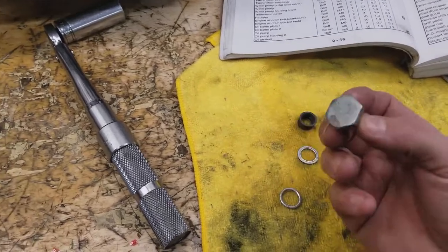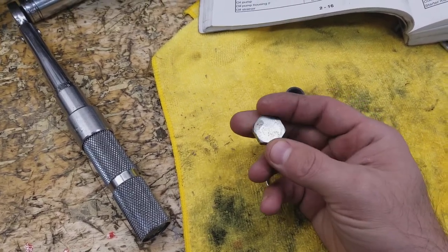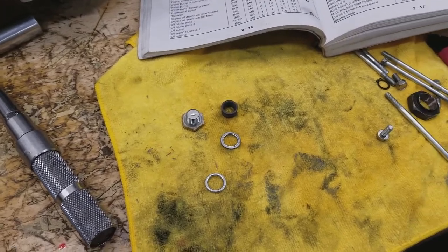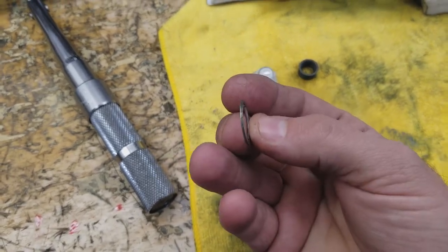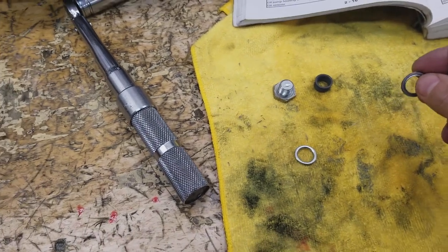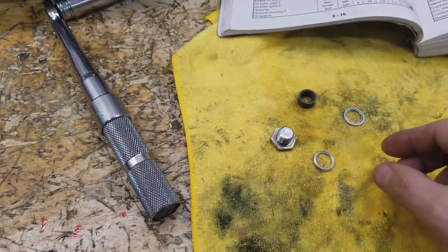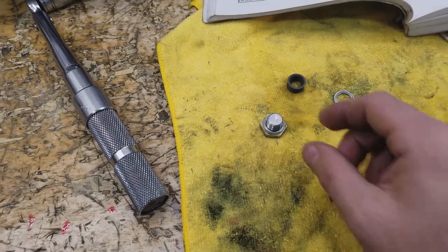Looking across in the index under foot pounds, we're seeing 17 foot pounds for the crankcase. That's really easy to over-tighten with the size bolt they supply on these engines, because normally with this size you're using a half-inch drive or a long wrench. The main problem is basically this crush washer from Yamaha — it gets flattened out, and if you don't change that crush washer, it doesn't give you really good feedback on how tight you're torquing that bolt. Every oil change, I recommend changing that crush washer. I believe they're about two bucks.